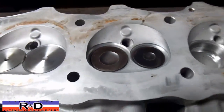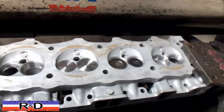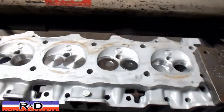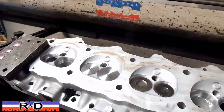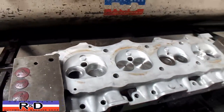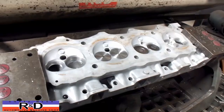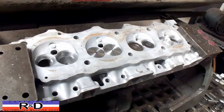So if you're looking to improve your performance on your Land Rover, this is one way to do it — add a small duration cam, a little bit more than stock anyway, and with this valve job and big valves you should be able to punch out a whole bunch of extra horsepower. John, Costa Mesa R&D, we'll see you soon.